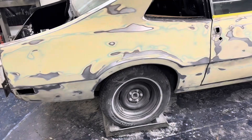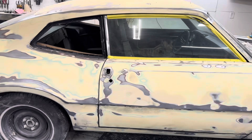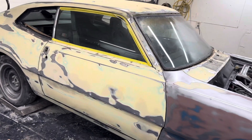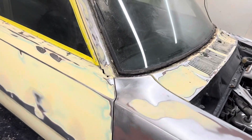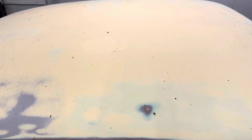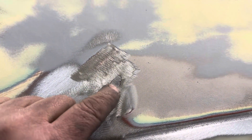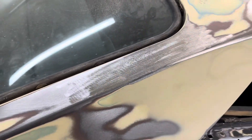When I got to the project, this is pretty much what it looked like. Brian and his dad shaved off the drip rail moldings, patched the rust, and got a new fender. It was sanded down to 240 grit or so. I came back through and sanded it all down with 80 grit. Doing that gave me the opportunity to find defects — there are some holes. I don't know if they're from an old vinyl top or what. And this is a factory lead seam.